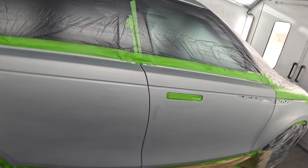Everything got stripped off apart from the handle mechanisms. Where I've had to feather out you can see there are a few layers, but you can't feel anything — it all feels good. I could maybe just put a blender coat over it to seal in and fill little micro scratches, then base coat it and clear coat it, but I've decided I'm just going to put a coat of wet-on-wet over these doors.